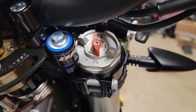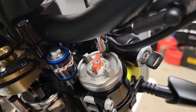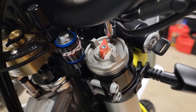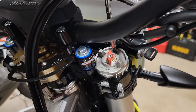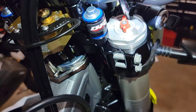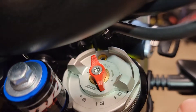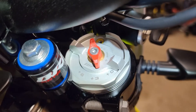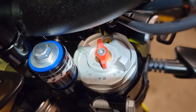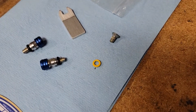Quick and easy — it's just a matter of removing this screw. It's fairly snug, which is good. I'm going to keep my old screws in the package the bleeders came in, so if I ever need to ship the fork I have access to those. Now, here's the screw I just took out. There's a yellow o-ring in there that needs to come out — if we double-gasket with the STR bleeder's o-ring it'll cause a problem. It didn't come out with the screw, so I'm going to use a pick tool to just pop that o-ring out.